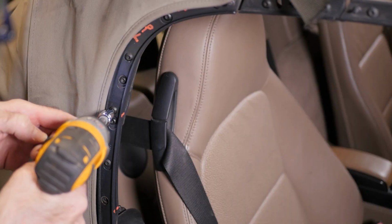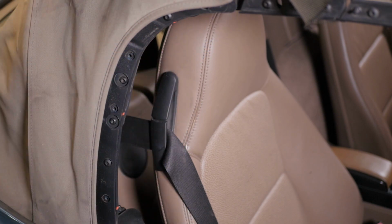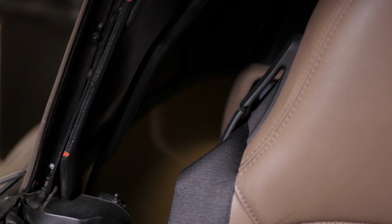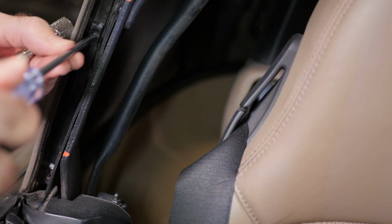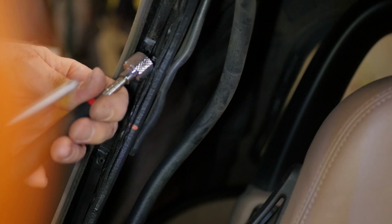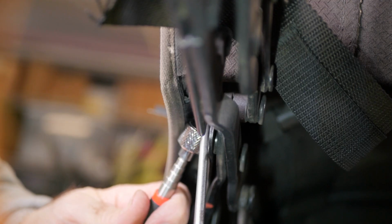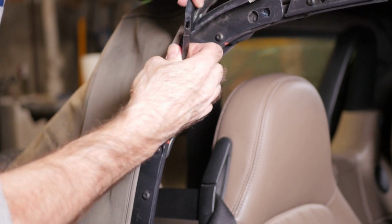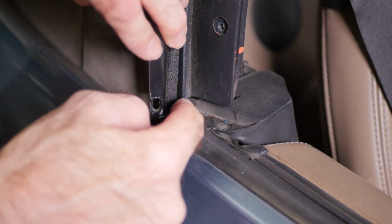The lower gasket brackets are held on with T25 bolts and need to come out in order to get access to the Phillips head screws holding the top to the frame. A telescoping magnetic pickup tool is your best friend. These screws want to live at the bottom of your car and will do everything they can to get there. The top then peels off, and at the bottom is a rivet that I ended up pulling through, then I drilled it out later.